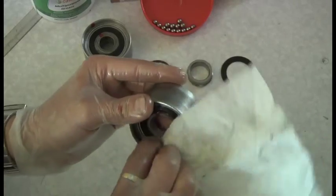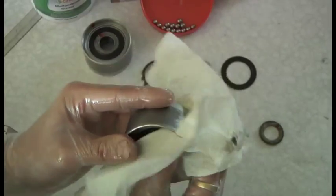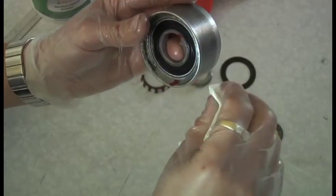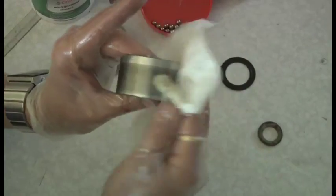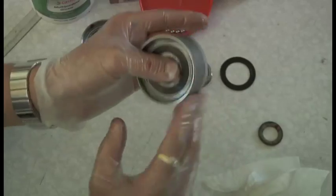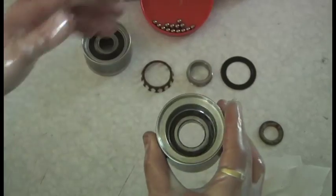There's no bringing them back. But bearings, if you kept packing them with grease, would last for years. These sealed bearings we have now - sealed for life, they call it - well, it's sealed for life because when it's run out of grease, its life is up. But if you took them apart, they would last probably 10 times as long. As long as they're lubricated, they last a hell of a long time. The thing that puts a life on them is the fact that we don't pack them with grease.